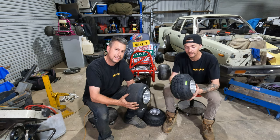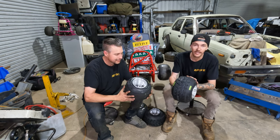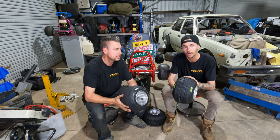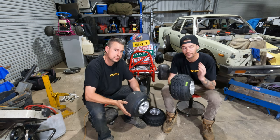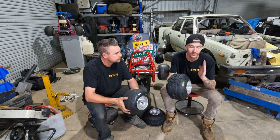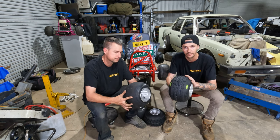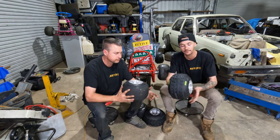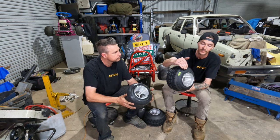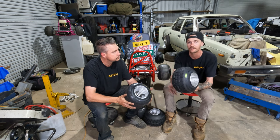You'll also find another application, like with our drift cars, as we talked about before. The reason that you put a stretch tire on a drift car is because for stance and for looks, you hang the rim outside of the guard or flush with the guard. Doing that, the tire then destroys the guard. So you stretch the tire up to make the guard come down, and if you get it perfect, you won't be able to fit anything at all between the tire and the guard.